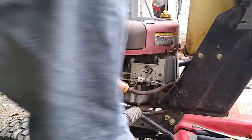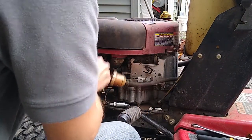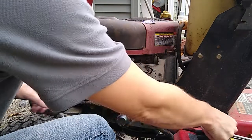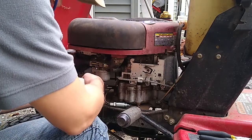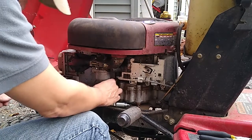To swap this out, I'm going to disconnect the fuel line from the carburetor and lift it up to stop it from leaking. This is necessary because we're going to be taking this solenoid out of the bowl, which will let the gas out of the carburetor. I unscrew the fuel solenoid — this one has half-inch flats — and collect the fuel in an appropriate container.